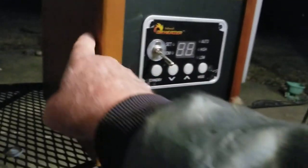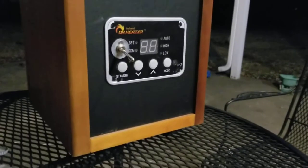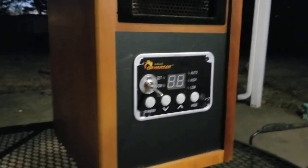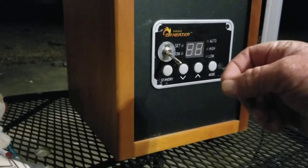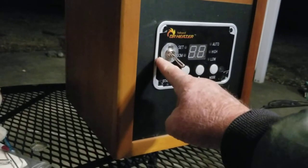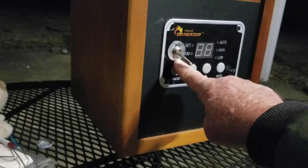There's a black line that runs back up into here — that was the negative. And the black line that runs in the front and around, apparently, is the positive. So what I did is I bought ring terminals. I cut the lines, spliced it, crimped them down in the ring terminals, and put the ring terminals on the back of this. I bought this extra washer here for the front at Ace — $0.23.